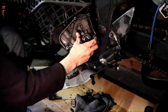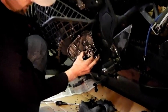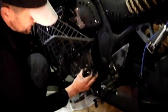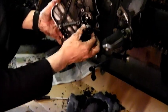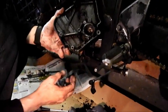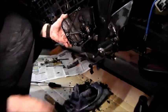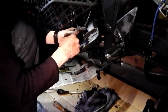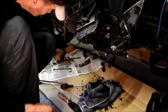All we do now is reach up on the bar, pull the clutch in - as you can see it just pumps it out just enough. If you pump it again and again, it will keep pushing fluid down until it brings out the piston enough for you to get a hold of it. That's the fluid that's in the cylinder. You can do it other ways - my mate John has a method of just taking the thing out and blowing it out, literally putting your mouth over the end and blowing it out. I wouldn't use an airline because you don't need that much pressure.